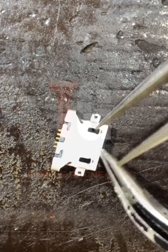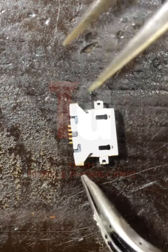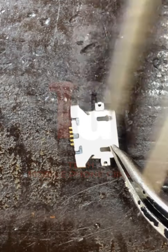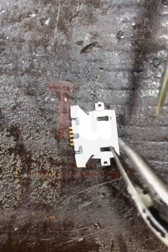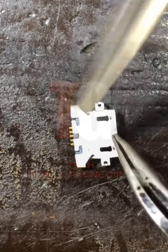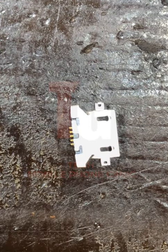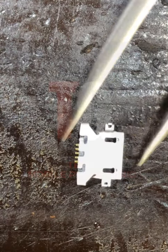When fixing a charging port, look at the legs — make sure the legs are good. Don't just mount your charging port on the board like that. Make sure you scrape these five legs with a sharp blade. Once you scrape it, the gold insulating stuff will peel off. Scrape it off carefully. The reason we scrape it is so the leg will solder immediately. If you try to solder the gold-coated legs, it will give you a problem. Once scraped, the color changes to silver, and then you just put your lead on it and you're good to go.